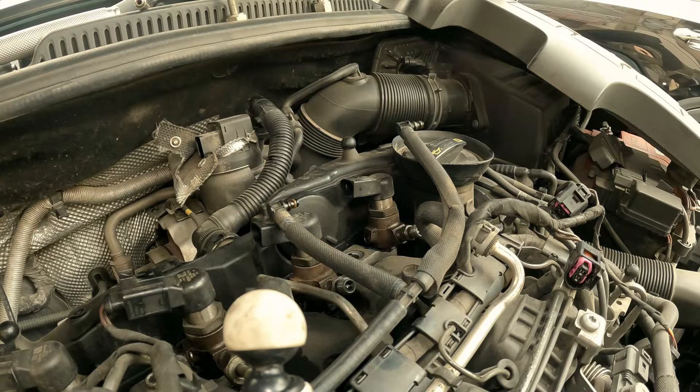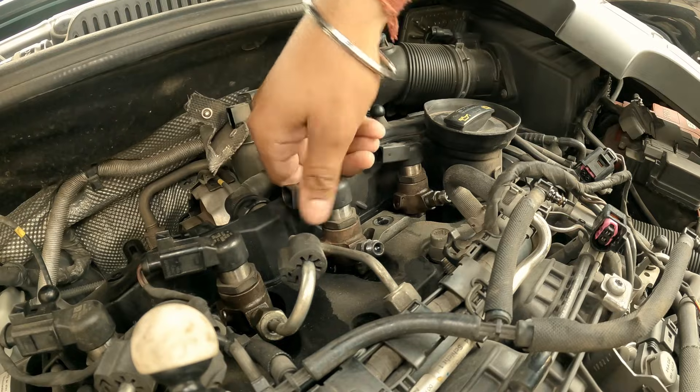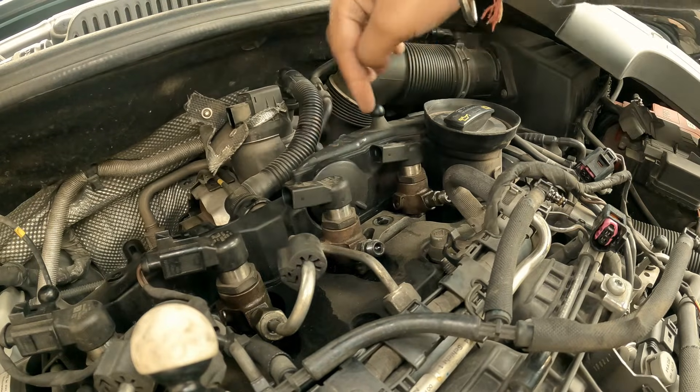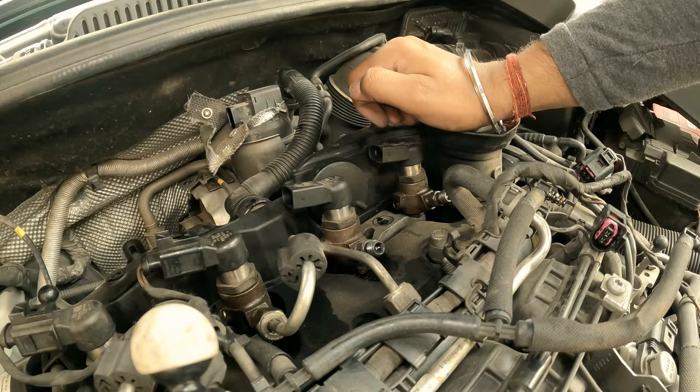This is not a bolt that was tied down very tightly — it is a small threaded bolt. You don't want to over-tighten it because it will break. It is also a TTY (torque-to-yield) bolt, meaning it is supposed to be used only once, but I'm just having a look so I'm going to reuse it. My rubber gasket is on order and I'll replace it when it arrives. Now we can rotate the injectors a little bit and do a jiggle-wiggle to pull both of them out at the same time.